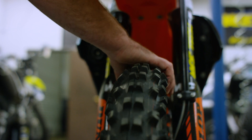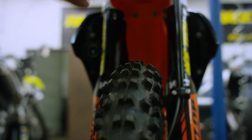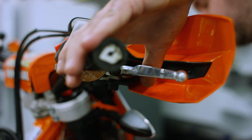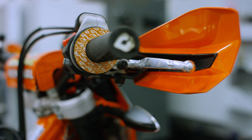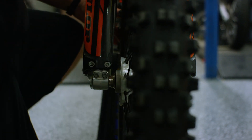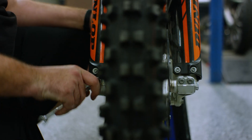Next, make sure the front wheel is perfectly straight. Spin the wheel and jab the brakes a few times — you want a violent jerk of the brake. That shakes the fork foot and lets it sit freely on the axle. Once you've done that a few times, grab your wrench and snug up your pinch bolts.